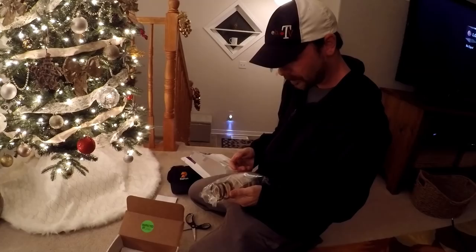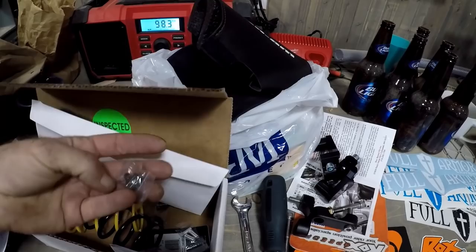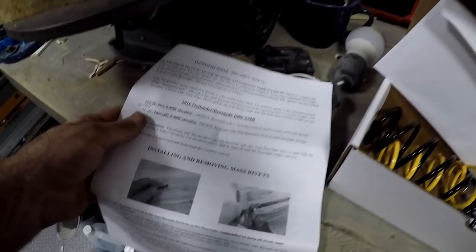So we're going to get into the clutch, boys, and we're going to throw a kit into it. Our friends from Dalton have sent us a gift. So primary, secondary, weights, and the inserts. We're going with a 2.1 gram, is what their charts specify for a 29 to 30 inch.